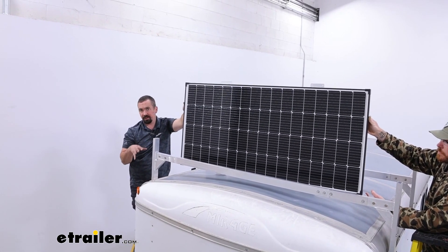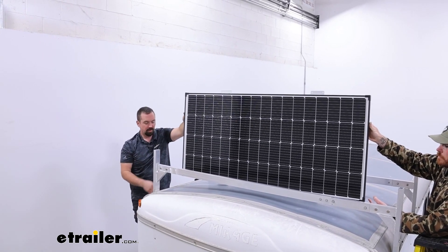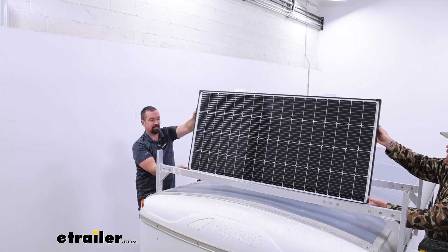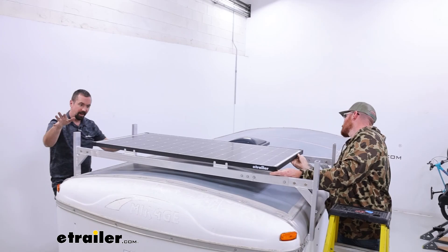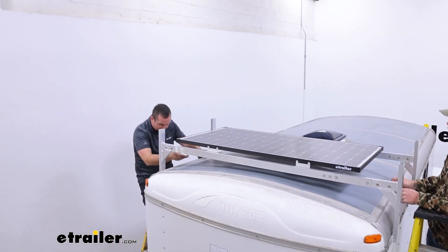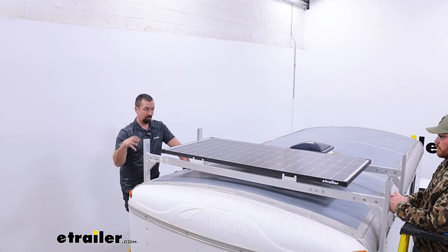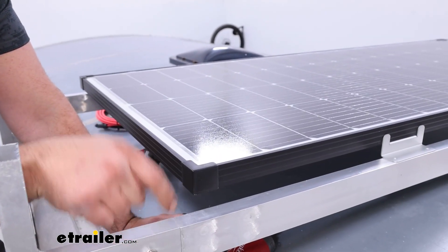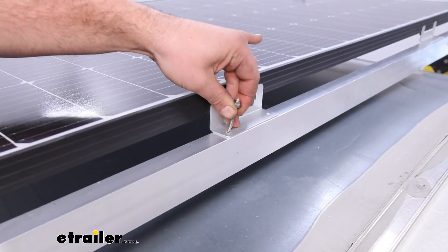For getting this mounted up, you need a nice solid mounting surface. We went ahead and picked up an aluminum ladder rack that we mounted on our enclosed trailer - this is the Rack 'Em Fits All, which is adjustable for an enclosed trailer and allows us to get a perfect fit for our brackets. You're going to need an extra set of hands to get this up in place. I highly recommend not touching the solar panel with your hands if you can avoid it. We've centered this up exactly where we want it, and included are self-tapping screws - we'll drill those into our ladder rack, one in each corner, then come back and put an extra one in each bracket.